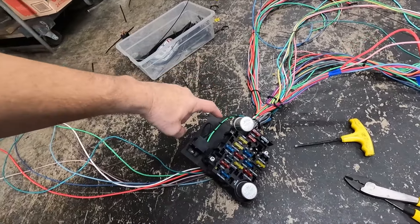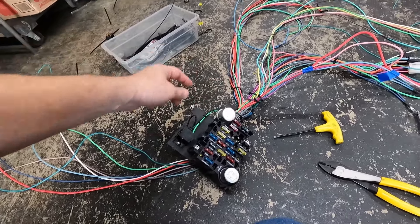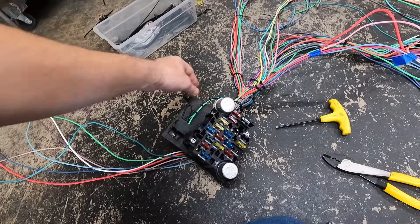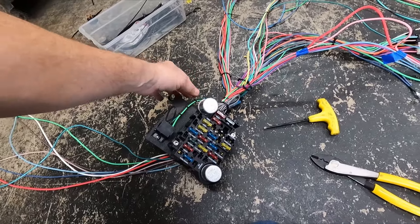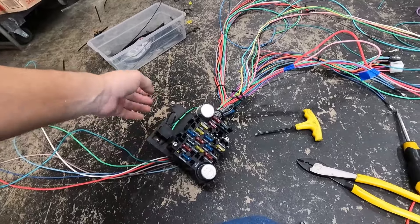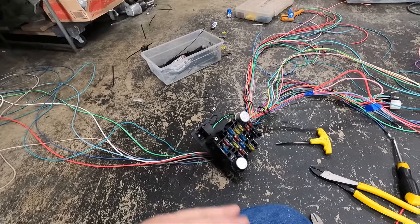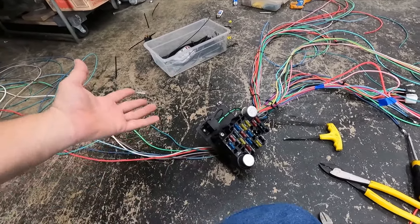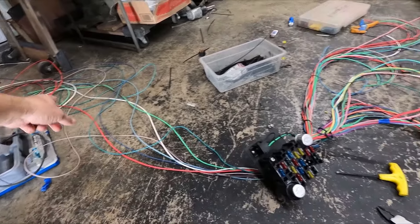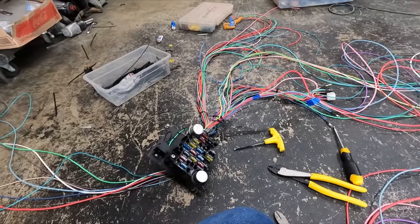The other thing I didn't like was the three wires for the relay — they were all three different lengths, wadded up and just didn't look good. So I went through and individually pulled each one of them all the way through. I put four little zip ties on there, cut it, and turned the zip tie clip part around the back. That'll look a lot nicer. You're really not going to see the fuse box unless you bend down quite a bit, but when you do look under there, at least it looks nice. Now I need to route all this through the firewall grommet, then I can mount this to the firewall.